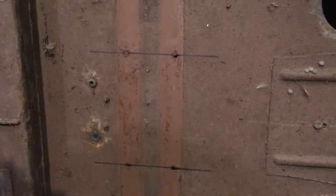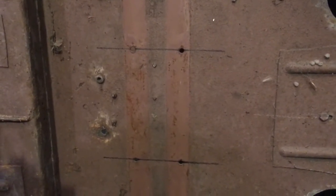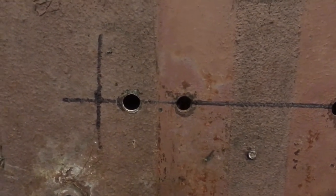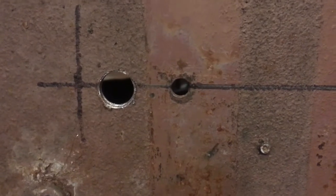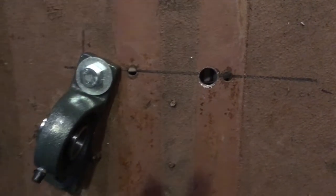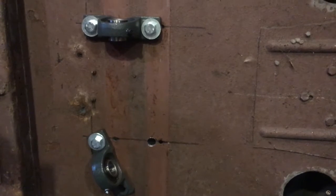To keep things square, I decided to use the existing holes as my center line for the pillow block bearing holes. I went ahead and drew some straight lines, and now I'm going to line up to see where I want my pillow block bearings to be. I stepped up to the biggest drill bit I have, which is a 3/8ths. My next biggest one is an oversized bit — turns out it's a 5/8ths, a little bit bigger than a half inch, but it should work. Got my hardware in on one side, marked up on my line. I drilled my second hole. Second hole is in — got the second hole put in for the second bearing.